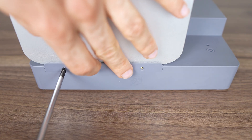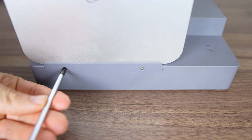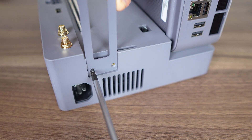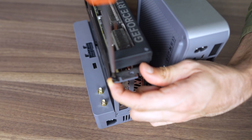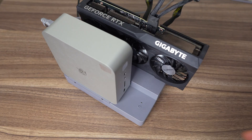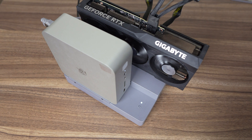To finish up the installation, screw in the mini guardrail for reinforcement, unless you plan to remove the mini PC regularly for transport or maintenance. Next, screw in the GPU bracket firmly to provide support. Slide in the graphics card and secure it firmly in place with the provided screws. Once the cables are connected, press the power button on the dock and then the mini PC. I've thrown in an RTX 4070 Super for testing. It's best to plug the display cable into the mini PC first, as you might not get any display through the GPU until the driver is installed.